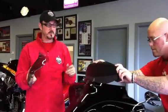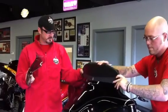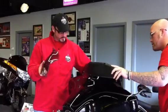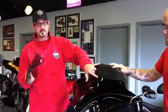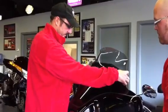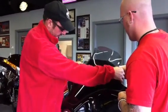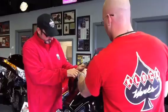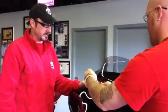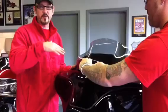You can see Vic's putting on the new T-Bags three-bag pouch, and that's been one of the more popular versions right now. You can see that it sticks up just as high as the Harley-1, and as it sits in there it's a good three inches above here. So as you're putting on the windshield, what you're going to want to do is just flex your fairing out just a little bit, drop it in, line up the center hole, put your screw in, and then line up the outside. You can see that this contour here allows for that T-Bag bag to fit down in there.